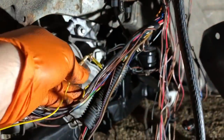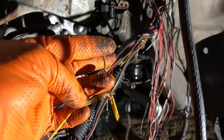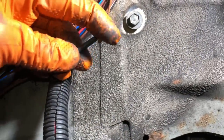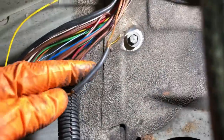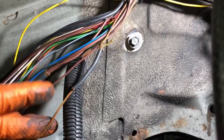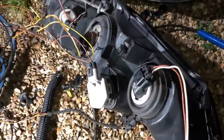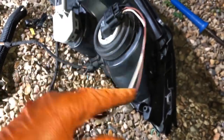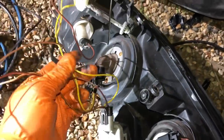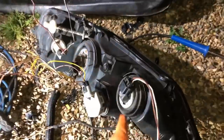I join them both in up here so I don't have to extend anything - just splice them in, simple. I've cut out those two wires and I don't want them going nowhere, so I'm just going to join them straight together with no loose ends. Same with the other connectors - any wires that go around to the other headlight, I'll cut them, join back together, shrink tube over, get rid of the tag end. That headlight is now done - most connectors share the same earths and you've just got the signal. It's really nothing complicated - earth, signal, and two wires for the motor.